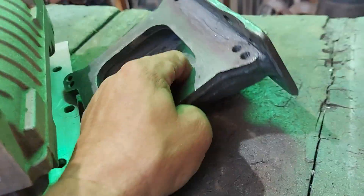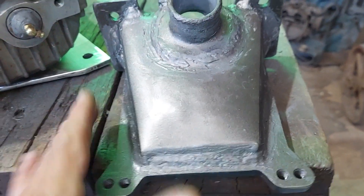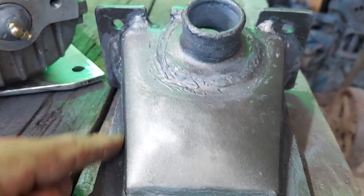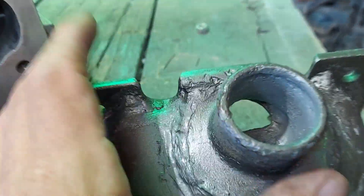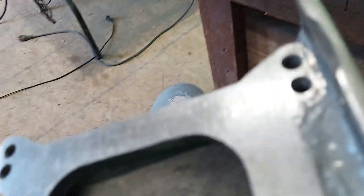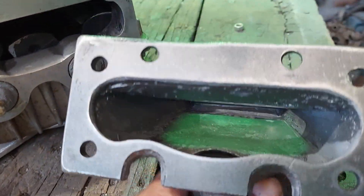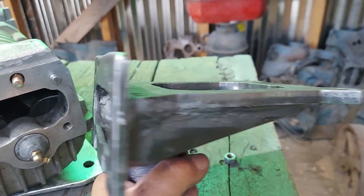Here's the plenum I had to fabricate. I got a carburetor flange, some 14-gauge sheet metal, folded it, welded it, and smeared sealer to prevent vacuum leaks. This port right here is for the bypass valve — you can see it goes through to the inner plenum — and I welded and sealed that on as well. I designed this to be as low as possible without being restrictive.